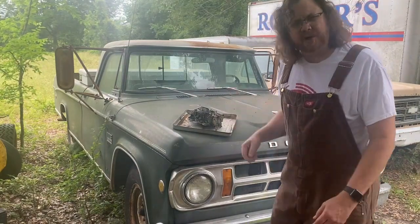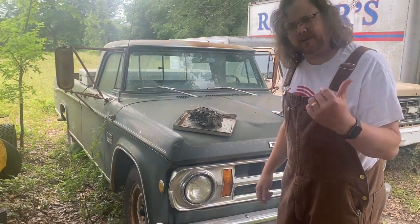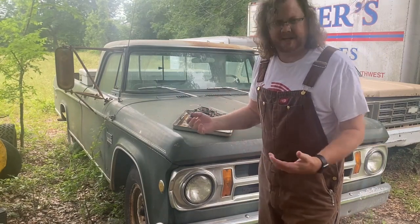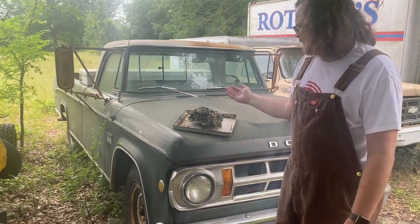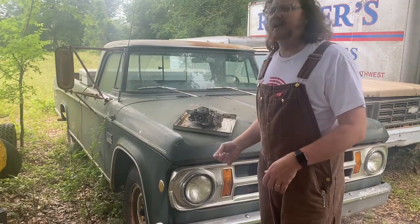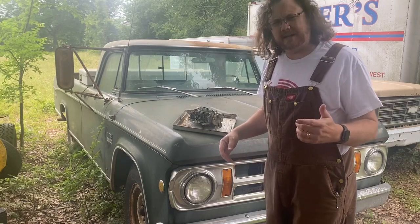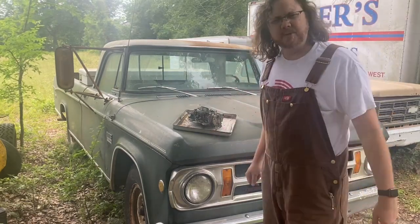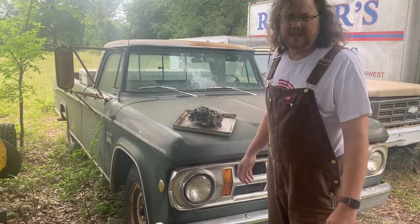When the truck was running rough, I put that Holley on it. Turns out — we've got another video on it if y'all want to check it out — it was actually a loose spark plug wire that was disconnected causing all the issues, not necessarily the carburetor. So I'm gonna see if I can put this Carter back on, see if it runs correctly, because I need the Holley for something else. Anyway, we're gonna spray a bunch of carb cleaner on this sucker, clean it up, slap it on there, and see what we got.